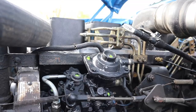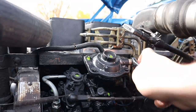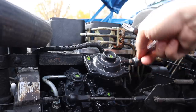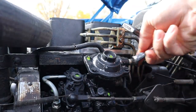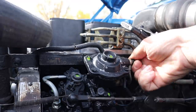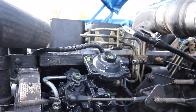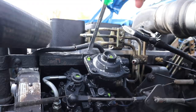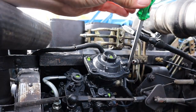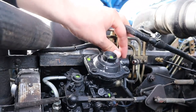Let's get to the install of the fuel pin upgrade. First thing we're going to do is break loose this line here that actually takes air pressure from the intake side and pushes it into the fuel system, helping with feeding fuel and keeping pressure in the pump. Don't lose the small washers on the front and the back of that thing. That's loose and that one's perfect. Don't lose these screws or you're screwed.